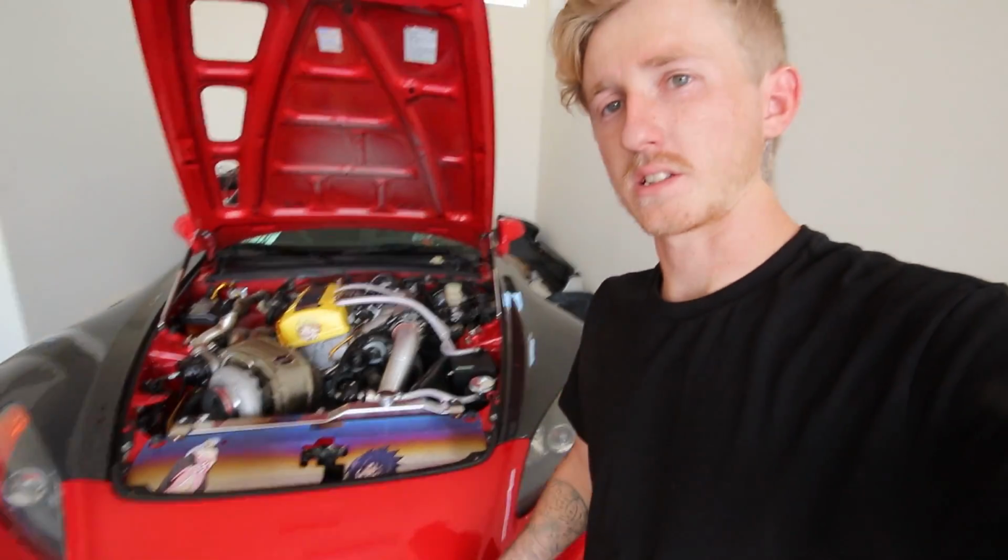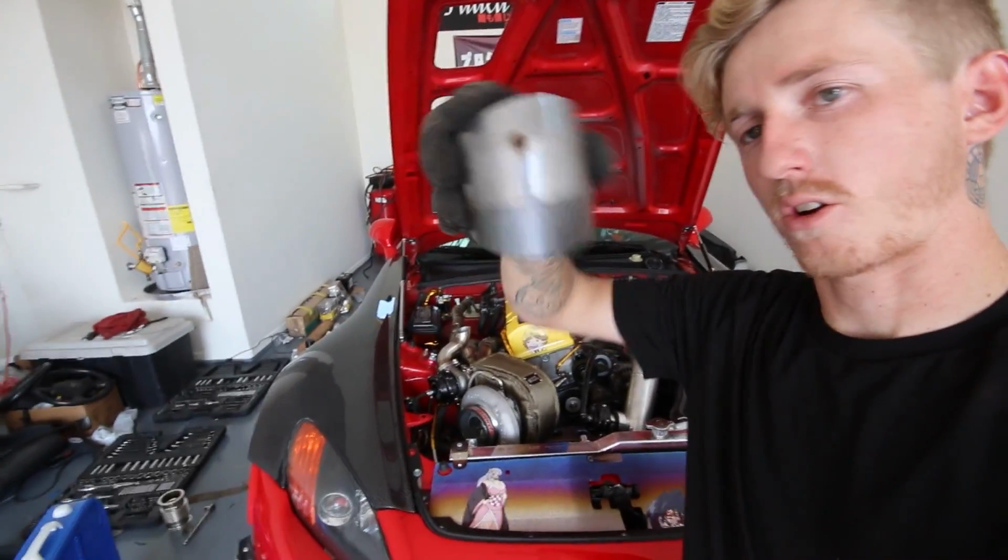I am here at the house now, so Vu and Brian just went to go get something from O'Reilly's. So I'm already getting started on the rest of the downpipe. Just trying to make a few angles, or a little bit of an angle, to get it from going down the side of the frame rail to curve under the car. Hopefully it'll be pretty simple and pretty quick. I'm just trying to get it all tacked up right now, get my angle or shape, and then they did have to go get a reducer while they were out, so I have to wait for them till I can even finish tacking it, but hopefully I can get this at least lined up with the test pipe, and get it welded.